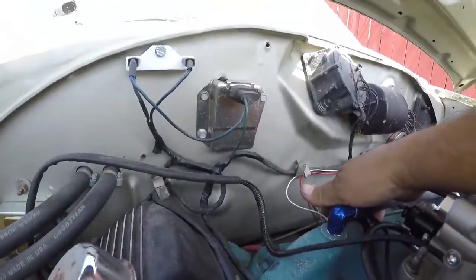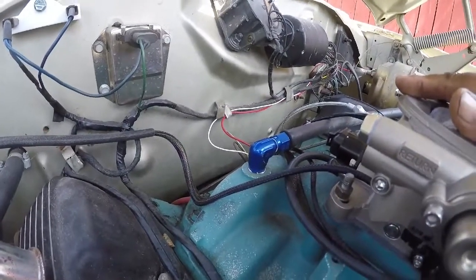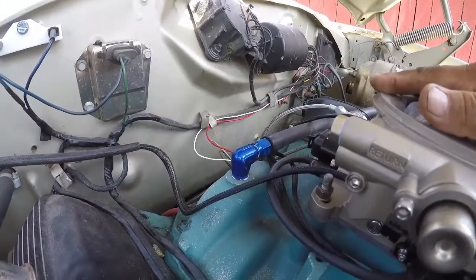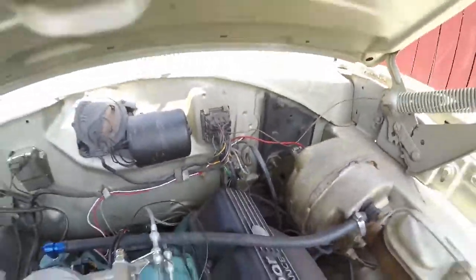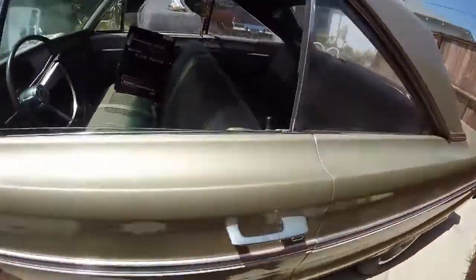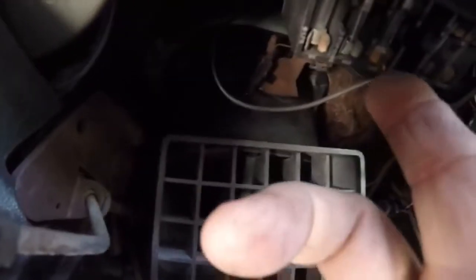The white one is keyed ignition. You have to make sure that it's 12 volt constant even when the engine is starting. So I ran that inside, and I'll show you how I put that on. I was going to connect it onto one of the bulkheads on the outside. This is how it's gonna be. It's gonna go right into this pin right here.